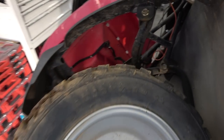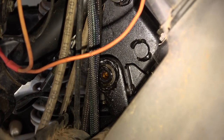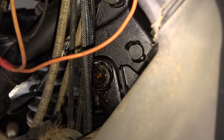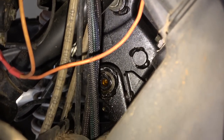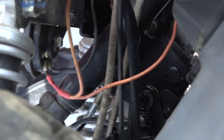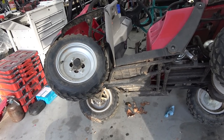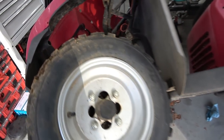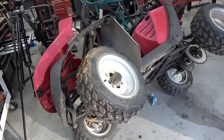So the problem is - what I found out - there's a mechanism down in there, there's an arrow on screen pointing at it. That little rusty hole there is where a bolt goes in to hold the brake pedal mechanism on that steel shaft. Basically what happened was water trickled down the chassis somehow. Because this thing was tarped quite a bit and then it's been in the rain for the last month. Water must have penetrated in between the shaft that that pedal pivots on. So I got PB Blaster soaking in it. We're going to soak it throughout the day and see if it frees it up. Because if you push the brake pedal down the brakes lock, but if you pull it back up the brakes are free - so the master cylinder is moving like it should. It's just that pedal mechanism locking up from no grease.